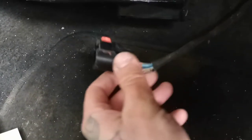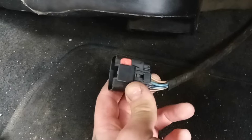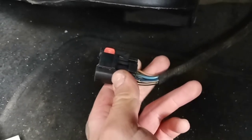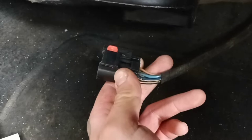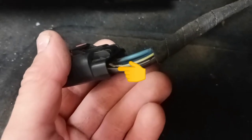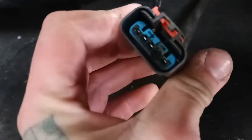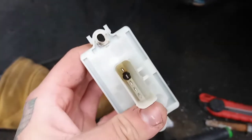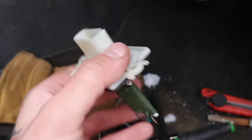Another 8mm screw — again should be two, just one. A little bit concerned about that as well. With this connector you have to undo this lock, which is just simply slide it to one side, then you can lift it — pushing in your thumb here. This sometimes gets jammed so it's hard to lift to get over the lock. I'll stick a pick in the end and just help it up. When I was working on this I see right here one wire is melted, which makes me worried. And if we look on this side — boom — one of those pins is burnt up. That's our issue, resistor let go, all black in there.